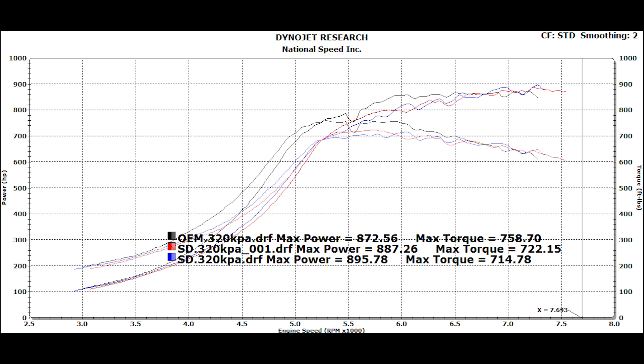The last graph was the highest boost level — same type of results. Based on the data, I would conclude that if you're planning on revving to 7500 RPM or somewhere in that range, I would stick to the OEM intake manifold.